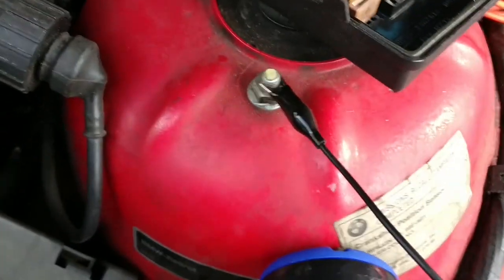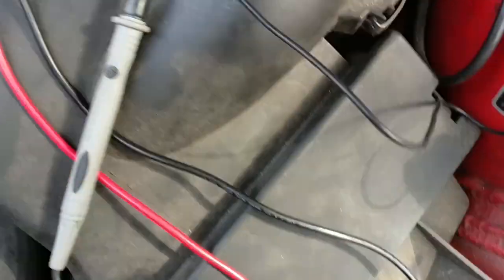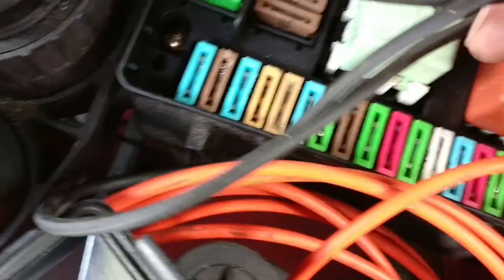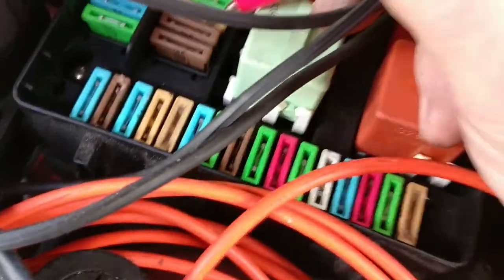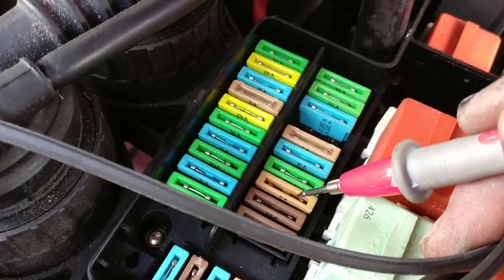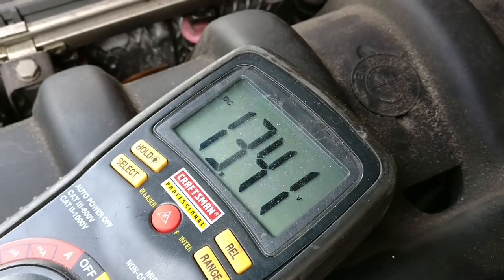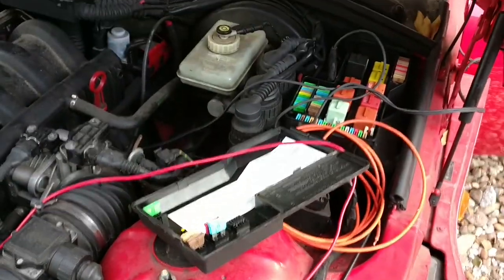Shock towers are usually a pretty good ground — ta-da! Now I can go poking around in the fuse box and see what's what. I peeled the plastic top off this one — she's a little five-amp fuse, not gonna hurt me too bad. Just poking inside here: 13.5 volts, 13.5 volts — we're good on both sides. And on the other circuit, 13-point-something, 13-point-something.